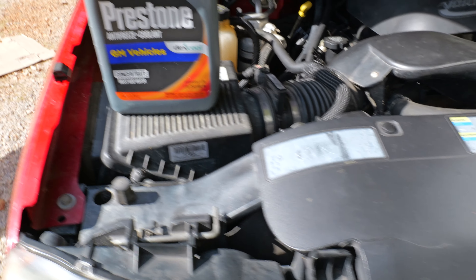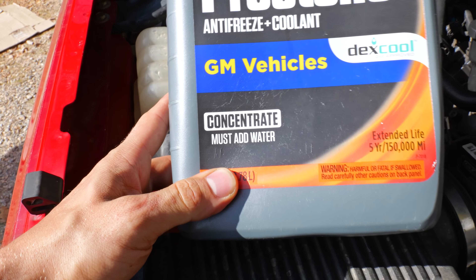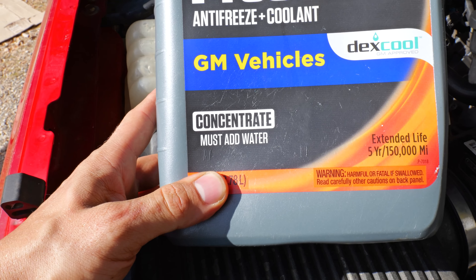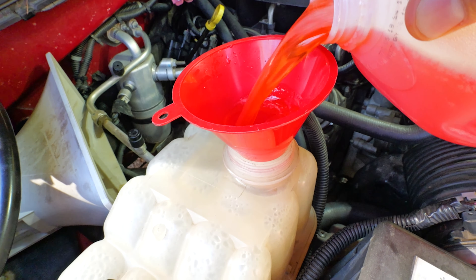You can't use pure water to cool because it'll corrode the system and it'll freeze, so you've got to mix it up with your coolant. This is pure coolant — see right there on the bottle, it says concentrate. You're not going to get the RTU that's ready to use, already mixed in the jug at the store. Here's the deal: you get half the amount of antifreeze coolant mix unless you mix your own concentrate. So this is a much better deal. 50% water, 50% coolant for these trucks — that's the ratio I use, I've always used, everybody uses. That's what I recommend.